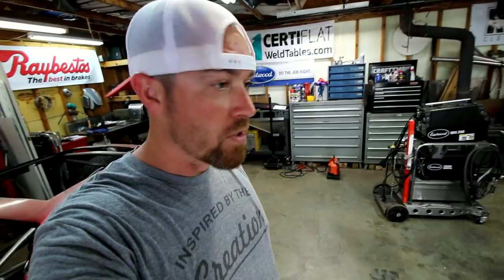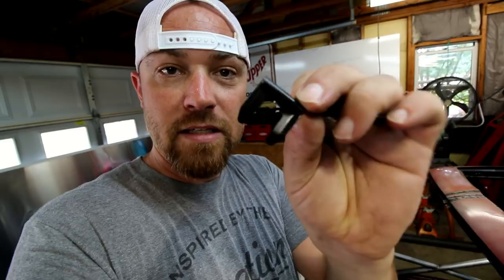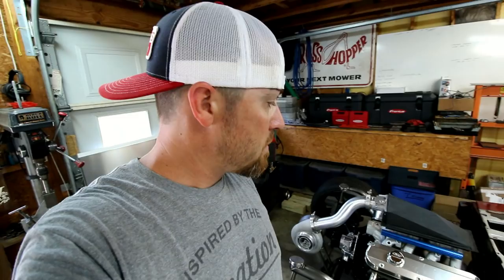One other thing I got — I believe I got these on eBay. So these are little brake hose tabs. They come with the little retainer clips and these are like weld-on. So I'll kind of notch these out, weld them on the chassis where they need to go, and that's where the brake lines off of the calipers will tie in. Then I'll just hard-line everything from there. I'll put two of those tabs on the rear end and two of those tabs probably just inside the A-arm on the chassis up front. Let's get these calipers coated and start putting this stuff on.